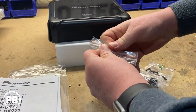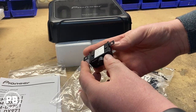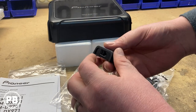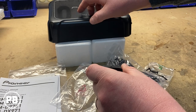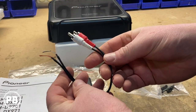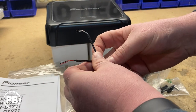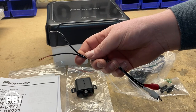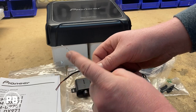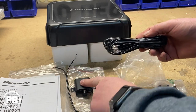Just to quickly look at our accessories. The bass knob that it comes with is pretty typical — we've seen this style with multiple other amplifiers from different brands. Those two screws will secure it, and the other end of the bass knob wire goes between this and the input on the amplifier. It's a line level adjustment, which is super nice, so the gain is digitally controlled through the amplifier itself. Because this amplifier can take high-level inputs through the RCA inputs, they provide this adapter where these ends plug into the amplifier input and these ends go to a speaker level that's already amplified. Most factory radios have built-in or external amplifiers, so you don't need a line-out converter — you can tap these into factory speaker wiring to provide your amplifier the signal it needs to play. And finally, you have a nice long bass knob cable so you can route your bass knob wherever you like.